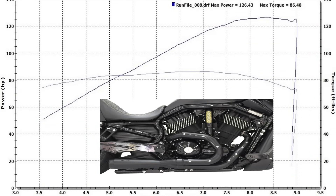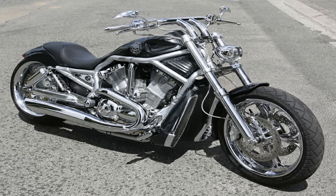If you've got to have a two-into-one on your motorcycle, the same rules apply — do the tuner, do the K&N air filter, and get your two-into-one exhaust. Looking at the dynograph with a two-into-one exhaust system, topless air box, and tuner, we're only looking at 126 horsepower. This is only a three-horsepower gain over just a set of slip-ons. So at this point you've really got to decide — is it worth the money to go from slip-ons to a two-into-one? If you like the look and sound of the two-into-one, absolutely go for it. But performance-wise, three horsepower for that extra money is pretty negligible.